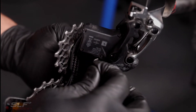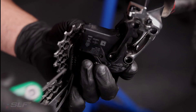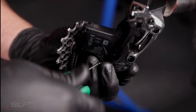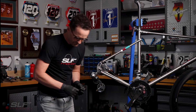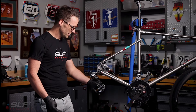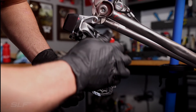Next step: reinstall the little metal fork. Now we'll reinstall the cover using your T6 Torx. Now we will remove the stop screw. Please pay close attention — this next step is critical. If not performed correctly, your system will not perform as designed. We need to create tension inside the derailleur with the spring. Rotate your cage up, over, and backwards until you can reinstall the stop screw.